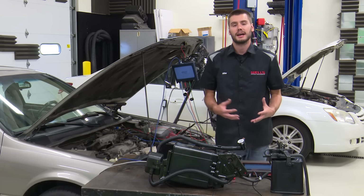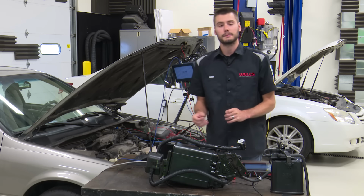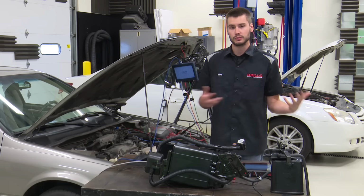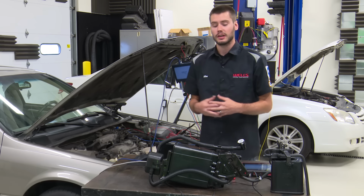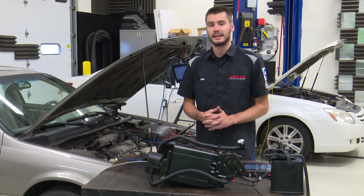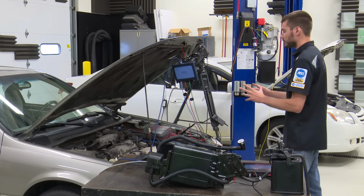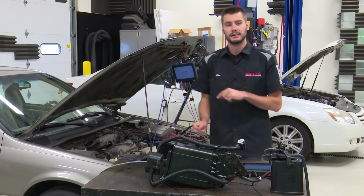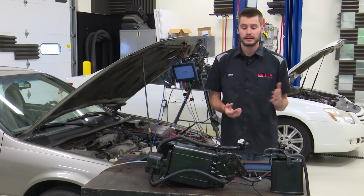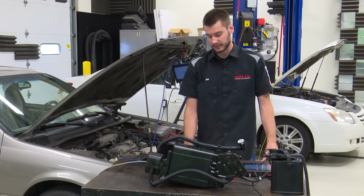This fault is most commonly tied to a bad vapor pressure VSV, the bypass solenoid being bad. Basically what's happening here is the computer has the bypass in one position, it moves it to the other position, and it wants to see a change between the two numbers. If they change, good to go. If they don't change, then it's going to think that there's a problem with the vent solenoid control circuit, basically saying that this is the test to see if the bypass solenoid is moving, okay? That's all it's trying to do. And in theory, running down the road in this vehicle, we should see vacuum inside of the canister and pressure inside of the tank. So a quick swing of that bypass solenoid, the fuel tank pressure sensor should go from vacuum to pressure and back when you swing that thing one direction or the other. So again, with the bypass, inspect for charcoal contamination on these vehicles.